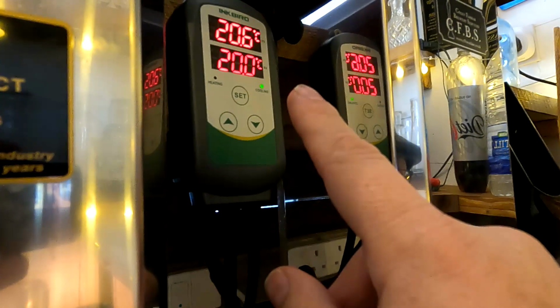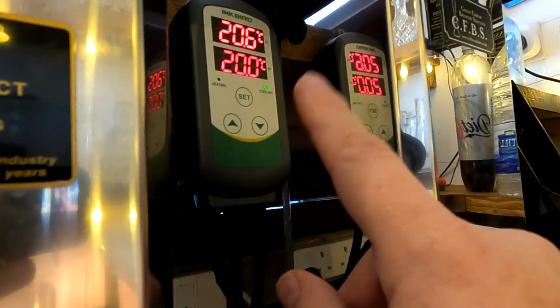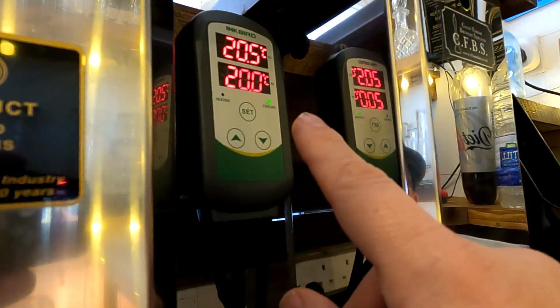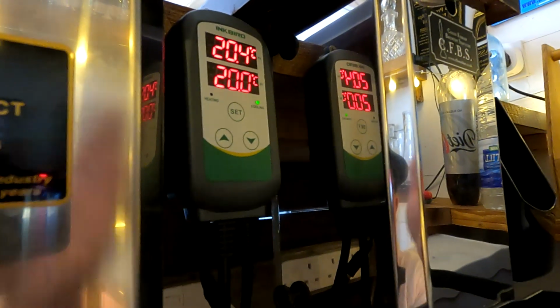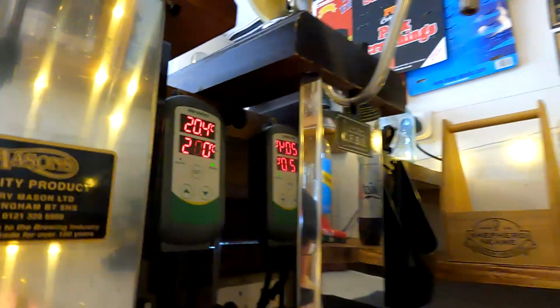You don't want your fridge going on and off, on and off, on and off all the time. You'll break the refrigeration unit. So I think I've set a 3 or 4 minute delay at the moment. More on that later. If you want me to do another video on that, I will.